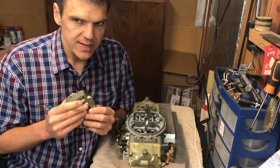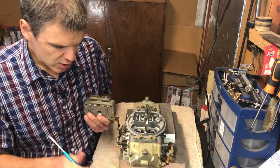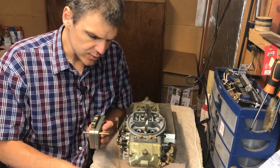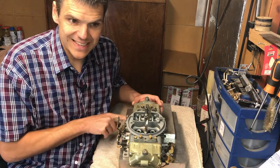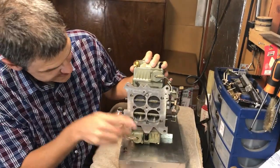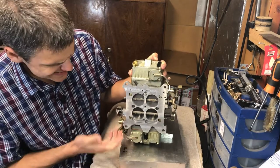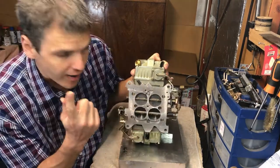This is a proper, solid, well-made product. Because we are adding quite a longer plate, it uses the normal Holley gaskets on these two sides, and the kit comes with longer screws. If you look at this, there is a pivot for the accelerator pump. You can see the accelerator pumps working with this bent arm arrangement, which means you can use the normal accelerator pump arms as normal.